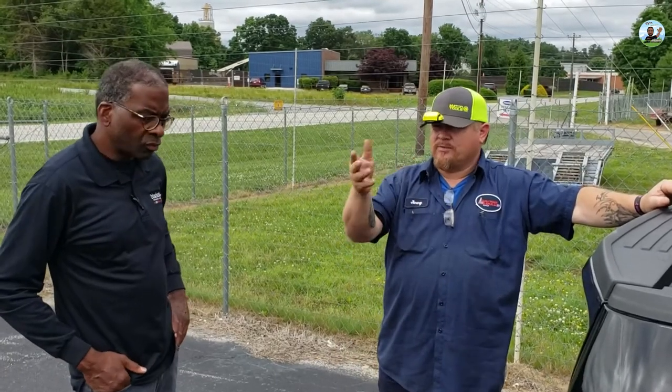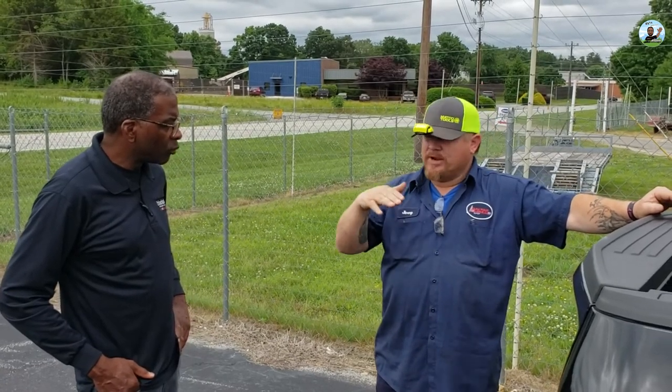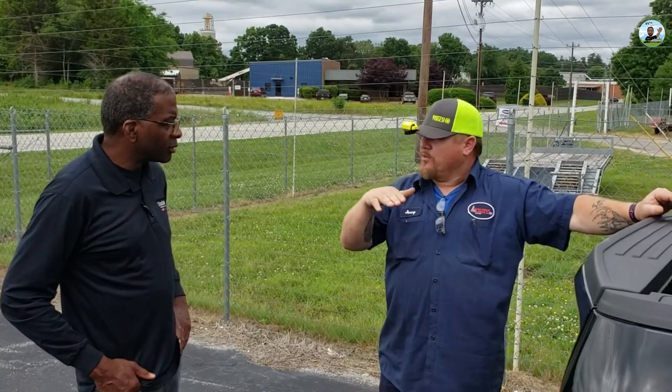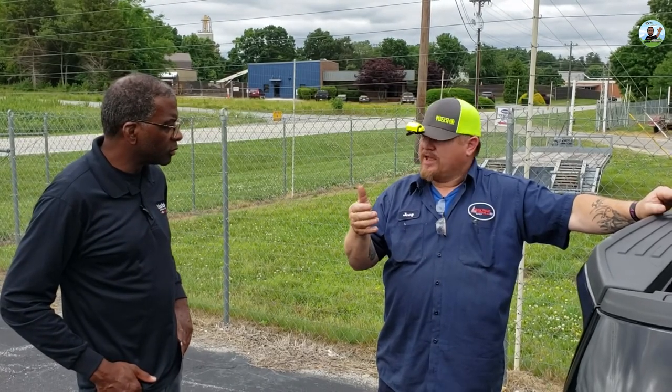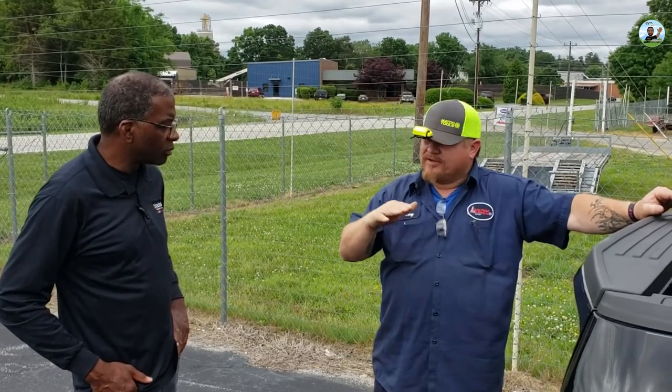My personal truck, when I had that big trailer a while ago, I was running 40 in it and hitting some bridges — it was just a little more than what I wanted. So I pumped it up to 50 and that felt perfect. At 45 I could tell it didn't feel right, and at 55 it was too stiff. So 50 pounds on that 50-foot trailer was perfect.